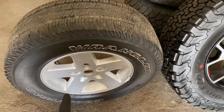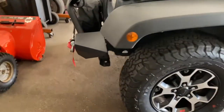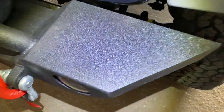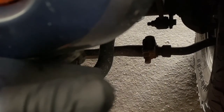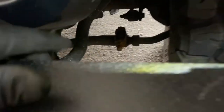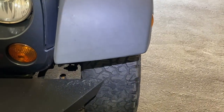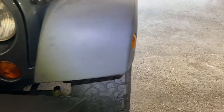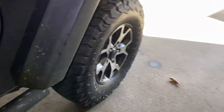I think it looks proper when it's lifted because the wheels are about an inch and a half taller, so if you raise it the other inch it's going to give you the look of the factory but with better rims and tires. Another issue guys have — you see the sway bar right here — when the wheels fully turn all the way, they may rub on the sway bar. Mine doesn't rub; mine has about an inch clearance. I don't need any wheel spacers, and the wheel is tucked into the fender flare as if they were always there, stock factory.